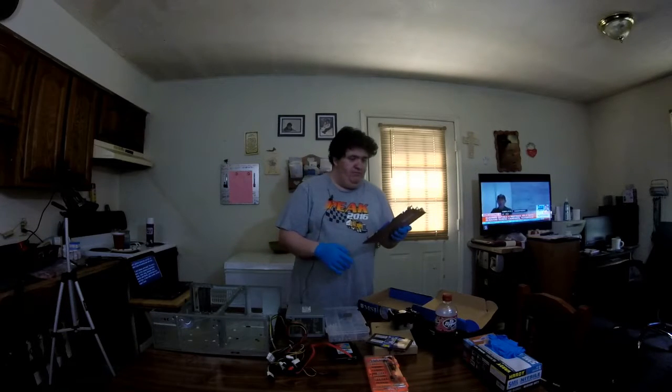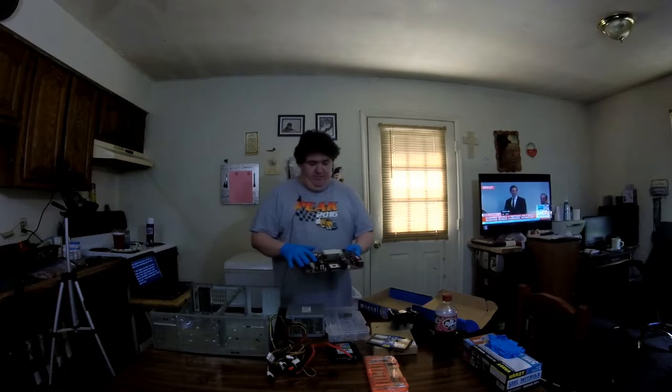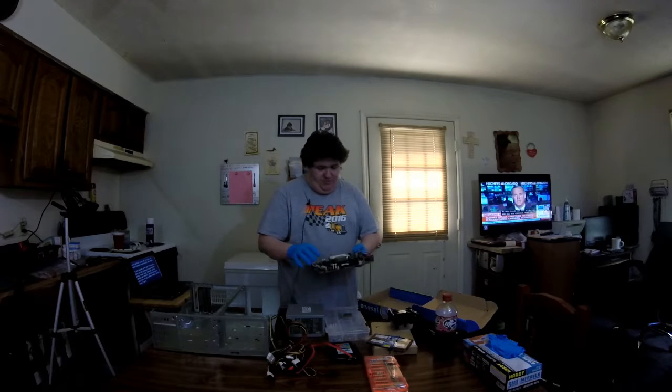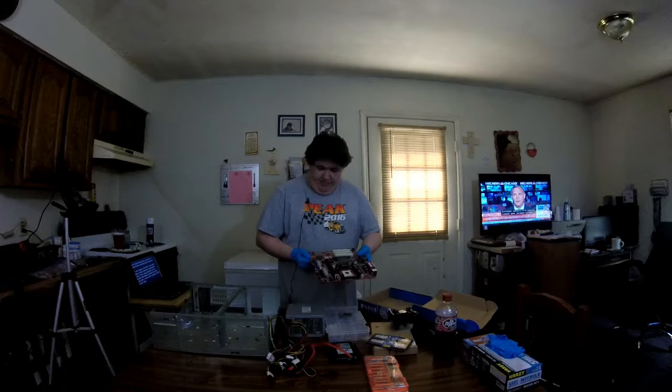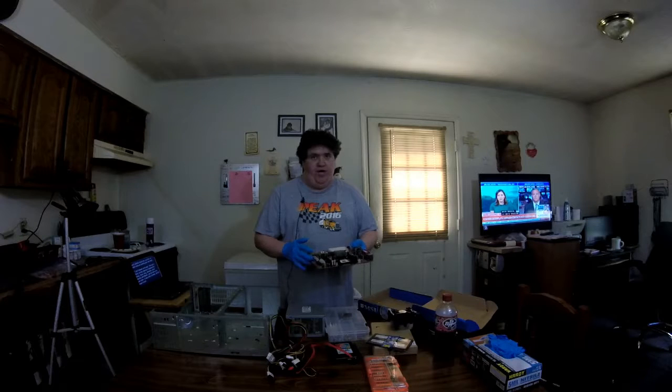So there's no bottleneck — well, actually there is a bottleneck. It uses DDR RAM, which I got for about $11. Two gigabyte total. Socket 478, like I said. It has two SATA ports with a SIS RAID controller — RAIDs 0 and 1. It has two PATA ports, which is the old style — ribbon cables and all that. Back then you had to set jumpers for master and slave if you wanted to use two drives on one port. Now we're lucky with SATA.